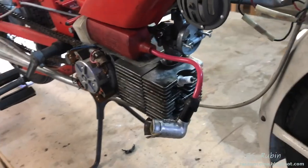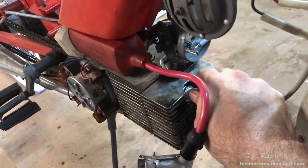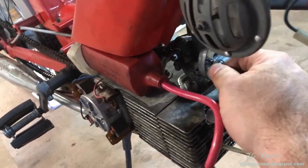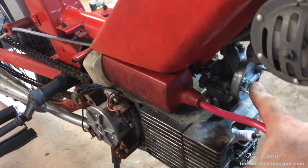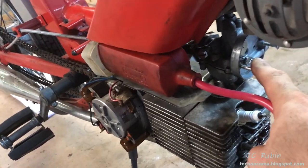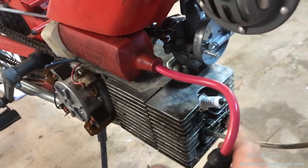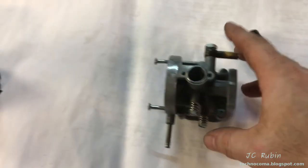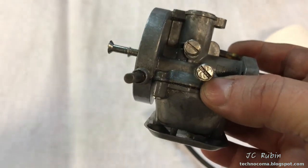We're back to it and this time we got it up on the table — oh, it's so much easier to work. What we found was that there is good ignition — the ignition coil is still working. I ran it on ether with a dry plug momentarily, in small intervals with just a little bit of gasoline mixed with ether after draining the tank. I think the bowl level is a bit high and the engine is flooding — looking in the engine it's just filled with gas. I'm going to take this carburetor off yet again and check the bowl height. I have a suspicious feeling that the seal that shuts the float is no longer any good.